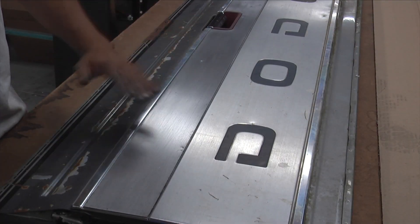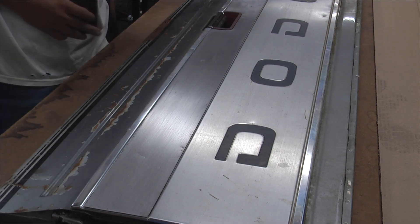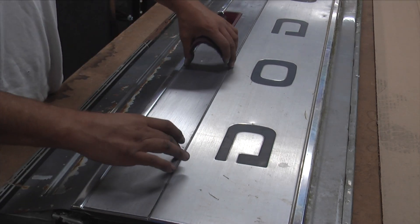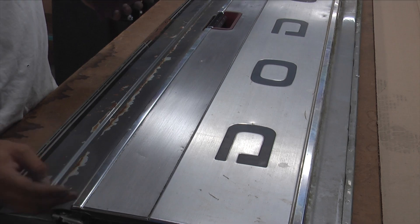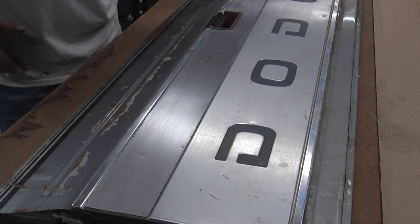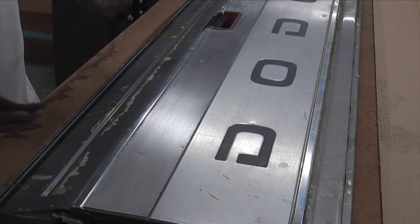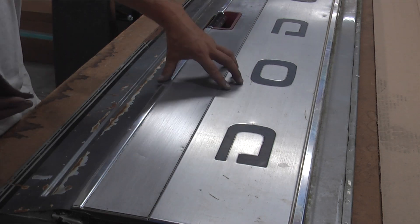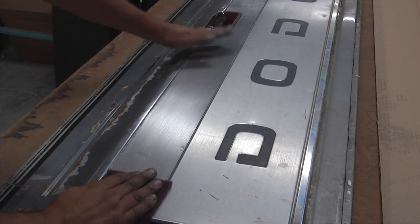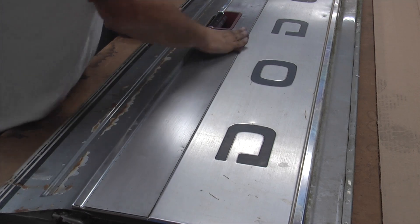Now we've finished with the main scour pad. You can see we've taken all the upper surface crud off — there are a couple of scratches and dings on this gate, and unless you want to try hammering out the little dings from the backside, this insert was actually a two-piece design when these tailgate trims were manufactured, so unless you can peel off the VHB tape the factory used, there's no real good way to get at the back. Now I'm going to go to the fine pad. You can already see the grain starting to show — this will totally change how this looks and it's going to start looking more polished and shiny.